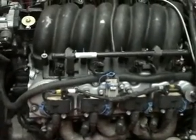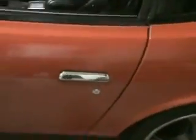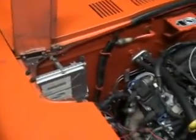I don't know. Oh, for the drive shaft, I also got it from JCI. It was already balanced and everything. It bolted right up. You basically have to specify when you're ordering which kind of drive shaft you need. So you have to go under your car and measure your differential. Not the differential, I'm sorry. You have to measure your drive shaft. Actually, I think I have my drive shaft here. Hold on. Yeah, I think it's right there. You have to measure the bolt spacing and how thick that little egg thing is. It's pretty easy. It bolts right up. Can't complain.